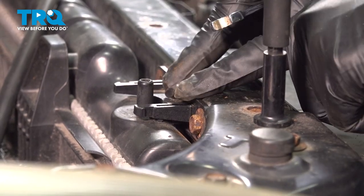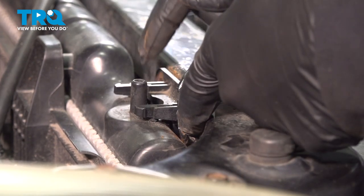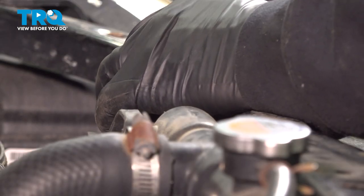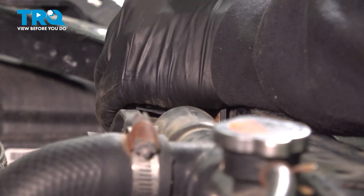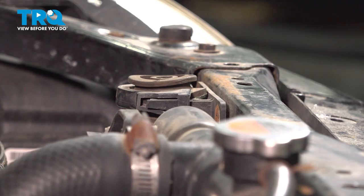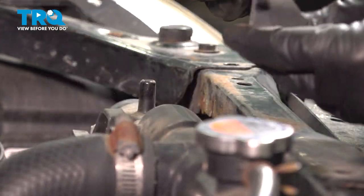On the top here, there are two brackets — one on the passenger side and one on the driver's side. There's normally a clip here with a rubber insulator to support the radiator, but ours is missing. Use your 10-millimeter gear wrench to loosen and remove it. There are normally two bolts here. Remove that bolt and set that aside. Go ahead and remove that bracket and the support, twist that up and off. This goes into the top of the AC condenser inside here, so set that aside.